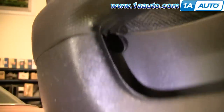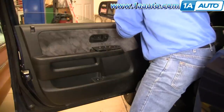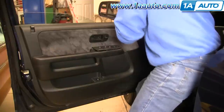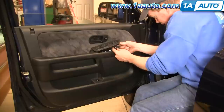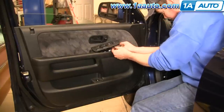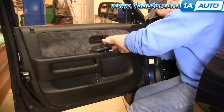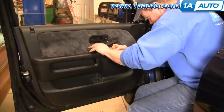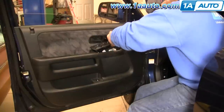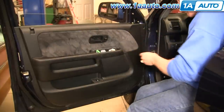You will see me remove two Phillips screws right underneath the armrest. Lift this up. There's a button on the backside of your mirror switch — press the button and work this connector out. Pull it up some. There's a green button on your window switch; you may want to use a little screwdriver. Push that green button in firmly and work that panel right up and out.